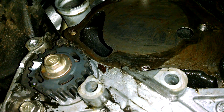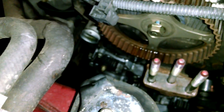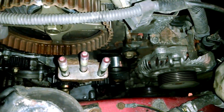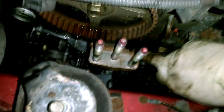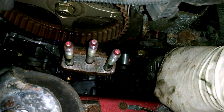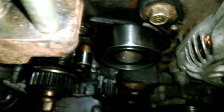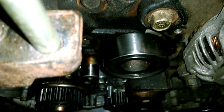It's only been about 40 minutes or so. You've got everything cleaned up really nicely — water pump is off, the area is clean, got all the oil cleaned off. Remember how I was telling you it's always a good idea to spin everything? You're listening for any kind of unusual noise. Well, I'm spinning this one — that's the sound of a future failure. This is why when you buy a timing belt kit you should not cheap out and just get a belt. Do everything — all the idlers, the pulleys, the tensioners, the pump, anything that's in there. That right there is only about 40,000 miles old but it's bad.